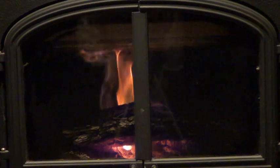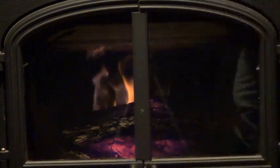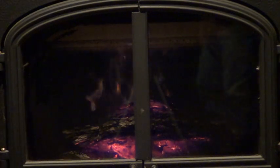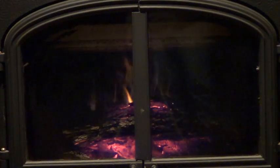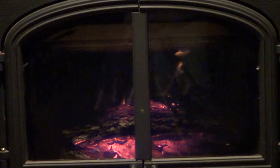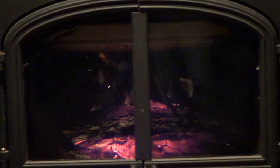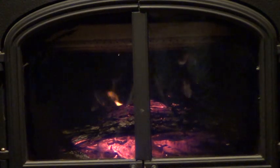I'm surprised there are still flames, because normally when it goes down to low you've just got your red coals. If I turn this back up, it takes a second and I immediately get more flames — it's letting more oxygen in there. You can probably see the coals lighten up a little bit. Then if I turn it to the ACC — that extra boost — you're just opening up the vent even more, and then you get a lot more flames and it really fires up.